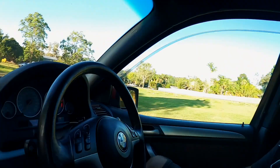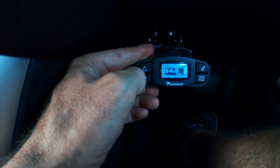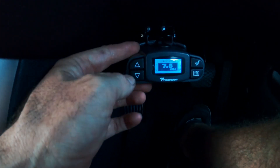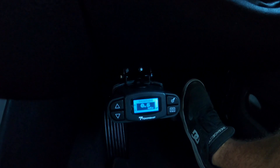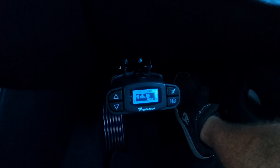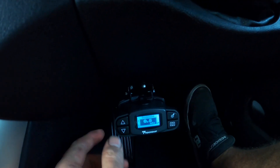I've been playing with all the different menus and I think we're going to have a bit of an issue to work out, because this is like the diagnostics mode. The car is running at 14.1 volts, which is what you'd expect for a car that's charging. The stoplight voltage — because the car is always checking for blown bulbs — it's got this voltage coming in. And obviously the trailer brakes use the brake light voltage to work out when to put the brakes on. If I touch the pedal, you can see it goes up to 14. So I'm not sure if that's going to have a play because it's doing the bulb checks.